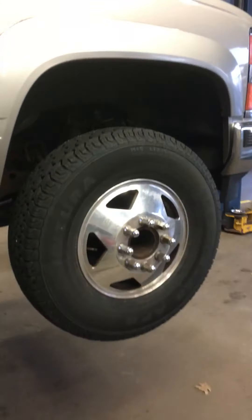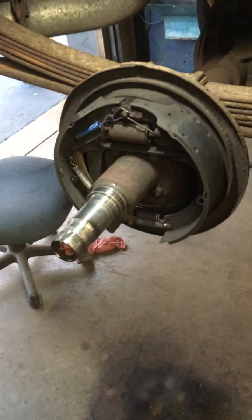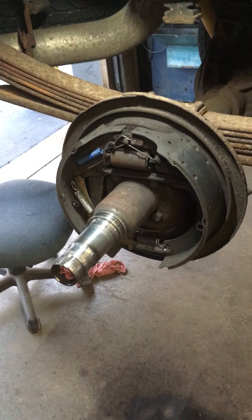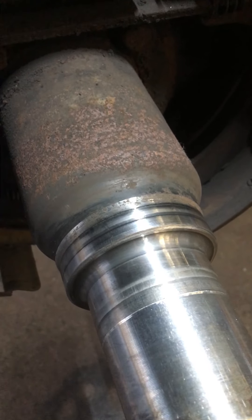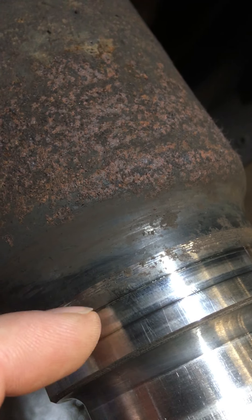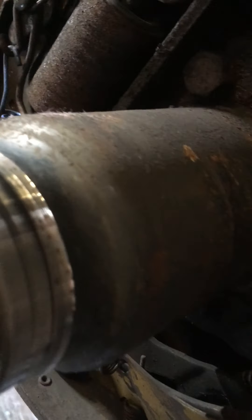Shiny wheels — well, not this wheel, but this wheel is shiny. End of the day, I figured I'd look at the old brakes on the dually because I knew this seal wasn't that great. I put a new seal in but the original leaked pretty bad. I cleaned off my shoes and they're actually doing pretty good — good thickness to them even after all the towing. The sealing surface has a little groove and a tiny lip to it, and whenever something's like that, I always worry about how good it is and how long it'll last.